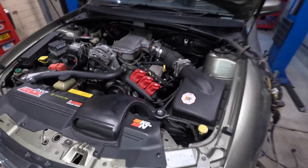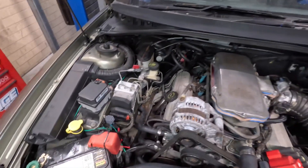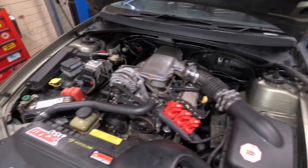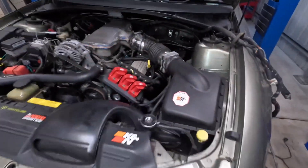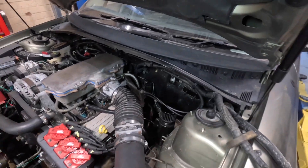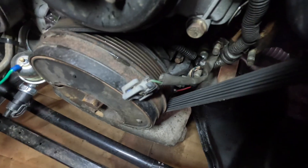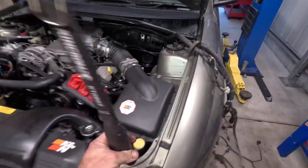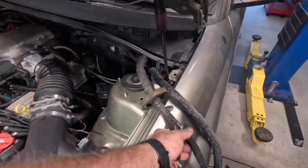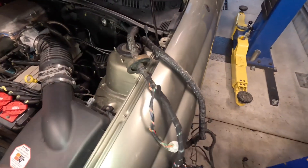That's all done - everything is all connected back to the engine as it was before. The only exception is the two or three plugs for the gearbox, which I've just cable tied up underneath the car off to the side. Besides from that, everything is connected and back together. There were a couple of little repairs I had to do to the wiring along the way. Also there's a plug down here for the air conditioning compressor which I've deleted, so I'll just cut that off. This is the section of the manual loom that's left - I've just got to feed that into the car and plug it all in.